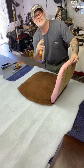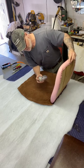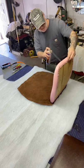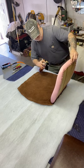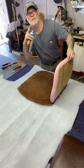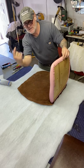You don't want to go over the edges because you want to pull this leather. You want to give it room to be able to, like I said, it's skin. It'll stretch. It's like vinyl. So you come up right to the perimeters and don't go over the edges. On the corners, you want to go a little close to the edge, and you don't got to go real heavy, just light enough. Come close to your edges, all 4 edges, close, but not over the hump, because then the leather can't freely slide, because after this, we're going to spray silicone around the edges.